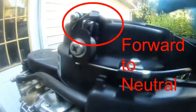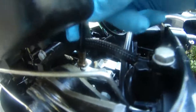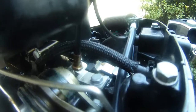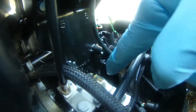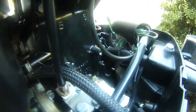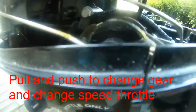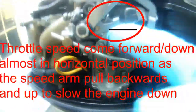See that? Changed the gear to forward, and this also linked to this guy here. Let's see. See this? It links this guy here, and there is a cable here that moves or connects down there to something down there to change the gear. So let me do forward again. See that thing back down there? There's an elbow link arm that links to the lower unit to change the shift. So right now it's forward.